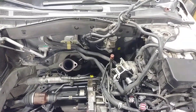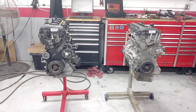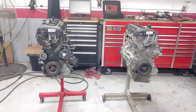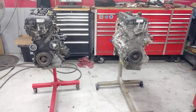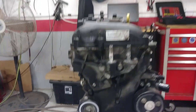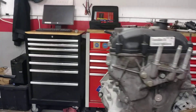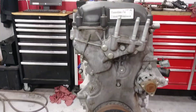I'm going to go over to the two engines — I have them on stands and I'm going to document some of the things you have to change. Here are the two engines: the Mazda 6 on the left and the Fusion engine on the right. These are the things you have to swap when doing a Mazda 3 or Mazda 6 swap. You have to swap the timing covers on both models. You can see on this engine the motor mount mounting point is parallel, but on the Fusion the angle is totally different — and that's built into the timing cover.